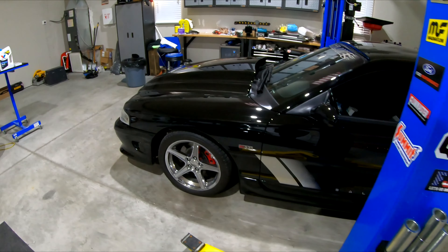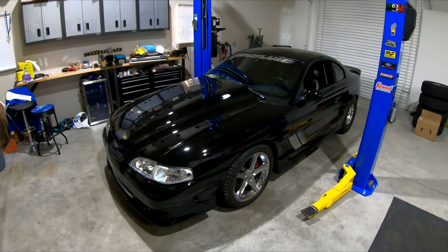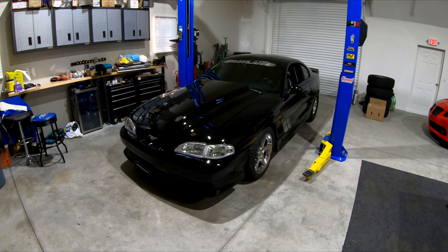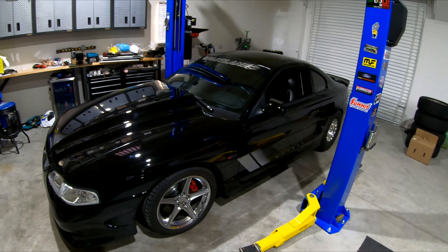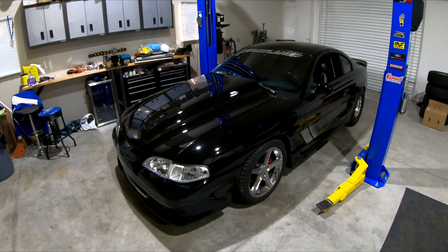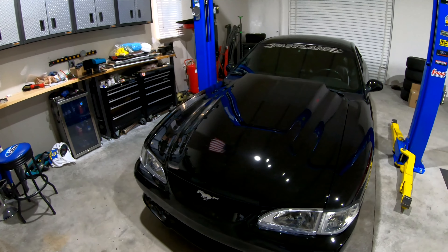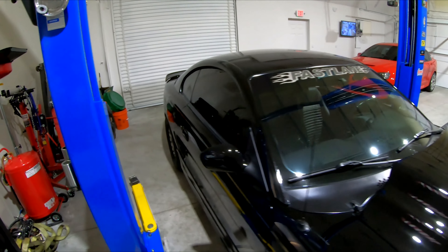I had to change my air/fuel around because on gasoline having the air/fuel like it was before was making it way too rich. You've got to manipulate the numbers — even though it's showing 10.0 right now, it's actually about a point or so higher than what I'm commanding. Long story short, there's a flaw in the Terminator X base software when you select E85 in the drop-down — change it back to gasoline. Coolant temp is up to 165 now and everything is working good.